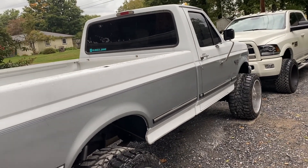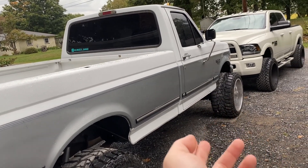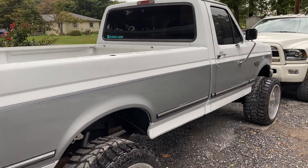Ball joints — at some point they're going to go. That's why I decided to do this side because it had some play; the other side doesn't, they're still good. I also wanted to give you guys an update and make a video about what will happen if you're running wide wheels on your trucks — you'll most likely have to be replacing a lot of steering components like ball joints, tie rods, stuff like that, because it puts so much stress on them. I highly recommend that whenever you do a lift kit or wheels and tires — especially if you're going 12-wides or pushing it to 14-wides — you're putting a lot of stress on those components. I still have to do the driver side, just replacing the camber caster, but we were able to get this side done.